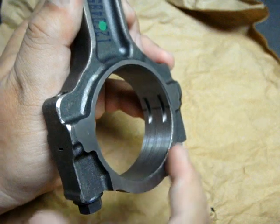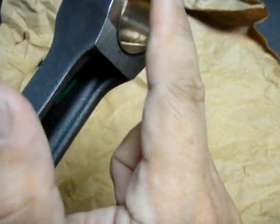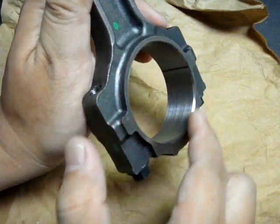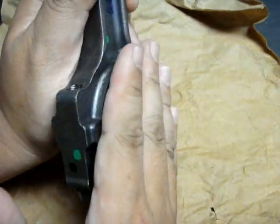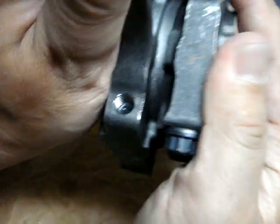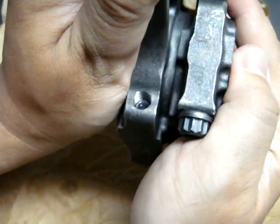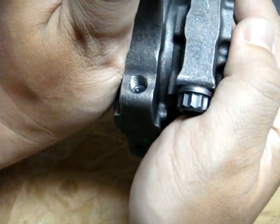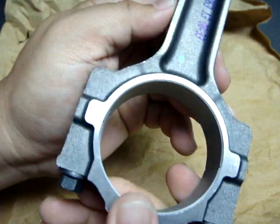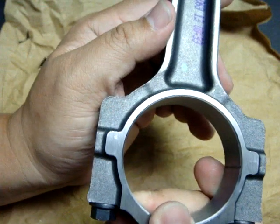The flash is created right here, also on this side up here at the upper end of the connecting rod, and again right here. It is machined down flat to cause a flat surface for installation on the connecting rod, so that it could also work in conjunction with another connecting rod on that same journal, and both of these rods together could work to turn two pistons.